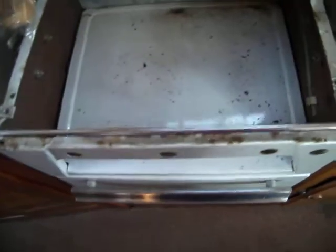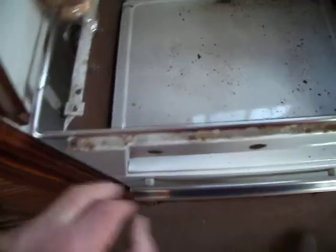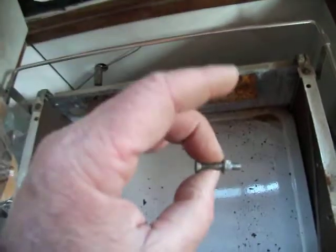Here's the suspect flexible pipe, which I imagine is what is leaking. Here's the cooker with the stuff out. That manifold was held in by two screws there and one in the corner. The ones in the corner are tall with the standoff nut — I'm not sure why, but other ones I've seen on the net are that way. The other ones are just little self-tapping screws.